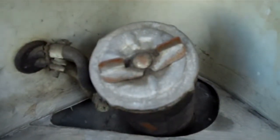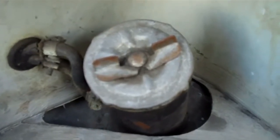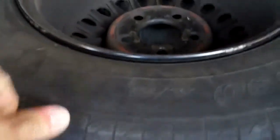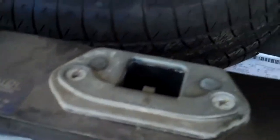The car has the wrong gas cap — it's not a Mercedes cap; it's a domestic aftermarket style, so it's going to need the correct style gas cap. The spare tire is flat with no air in it, so it's going to need five tires. Looking through the trunk, everything seems to be rust free, but I would recommend replacing the trunk weatherstrip because it is deteriorating and starting to fall apart. The fact that the trunk has not much rust will be short-lived if the trunk seal isn't replaced.